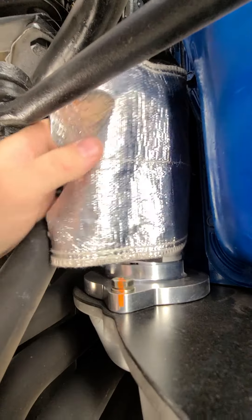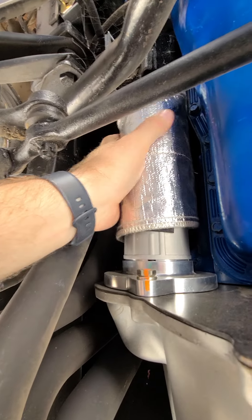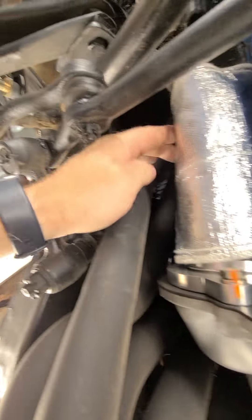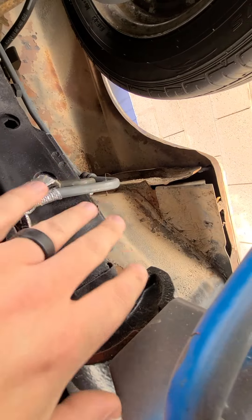Like I said, it's really just been small stuff. We wrapped the starter with a heat sleeve - I need to get some aluminum zip ties and get that tied up better, but it's velcroed right there. I need to slide that back up on there a little further and zip tie it up, kind of like that, so it's up out of the way. Repainted the exhaust because I had a couple hot spots on it. Got our fuel lines covered here because they run right by the header.